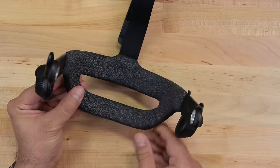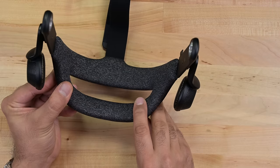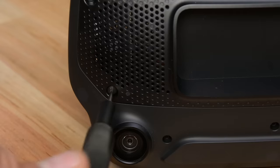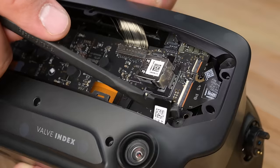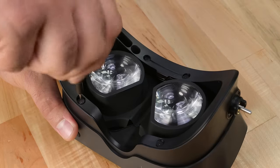Here's where the head strap falls short though — these cushions really need to be replaceable. Cushions absorb sweat, as anyone who's ever used a VR headset can attest to. Let's remove the front cover, which reveals the USB expansion port and several screws that give us access to the mainboard. I'm going to go ahead and disconnect a few ribbon cables, and with that I can remove the faceplate. And now it's just a matter of unscrewing a few screws holding the mainboard down.